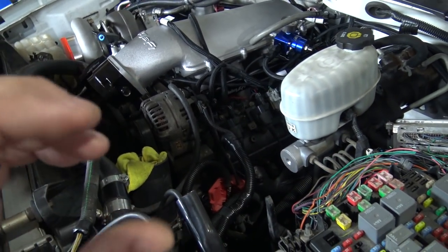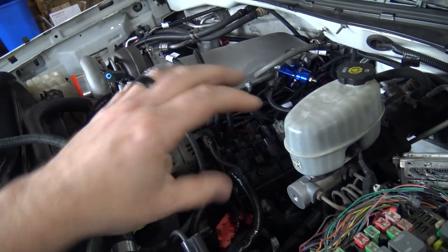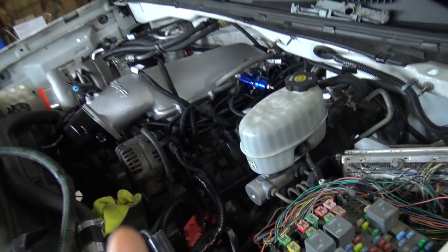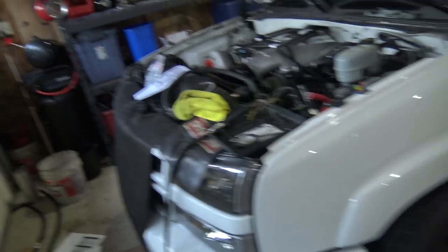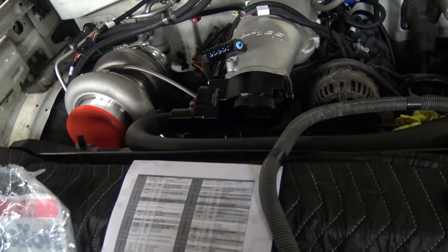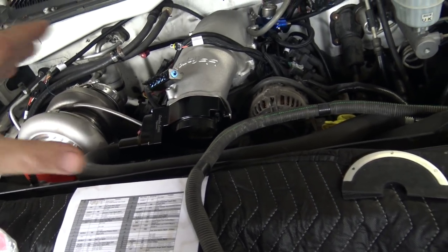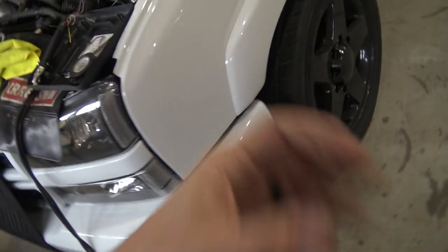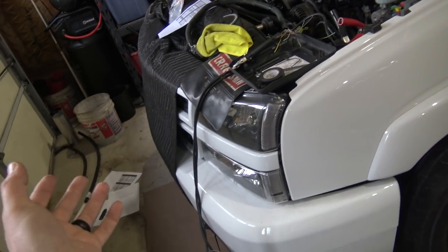If you're intimidated by this, you can just plug in the Holley engine stuff and get it going. If you're losing some functionality, just try to add it in as you go. Like I always say — if you want to do an LS swap and people say might as well go turbo and everything, that's how stuff gets backburnered. The cost comes up out of nowhere, you need to learn about it first. I always tell people: get the most complete engine for your money, put it in and make it run. A cam is like a weekend thing, and a turbo kit isn't that hard when everything's already running. If you want to do a build, just get it in and get it working and try to integrate stuff as you go — it doesn't have to be that hard.